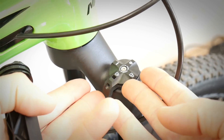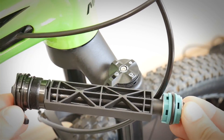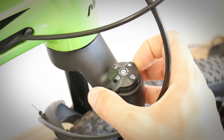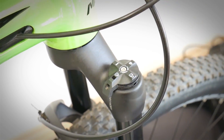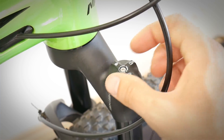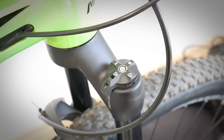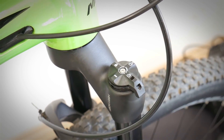We're going to be working on the right leg of the fork because that's where the damper is. This nice part is here inside the leg. We can see this — this is the lockout quick toggle, that's how Marzocchi calls it. It's open now and it's locked — easy. The mechanism we need is just a spring which will make it possible to open it up, because we're going to use the force of our fingers to lock it out and then the spring will be opening it for us.